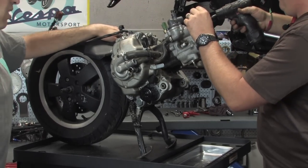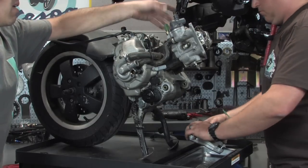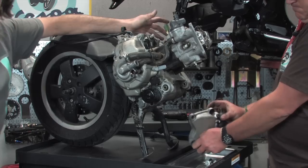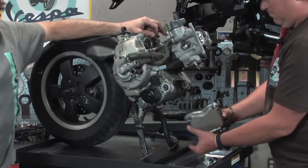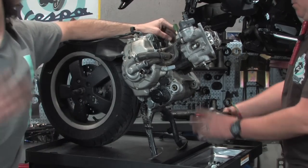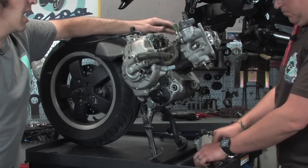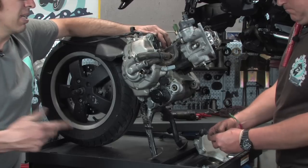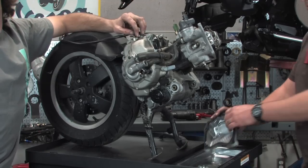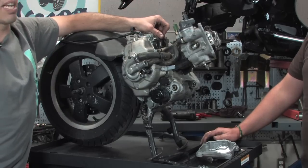When you attempt to crank this motor over, it doesn't even crank, because right now the combustion chambers fill with water because of problems with the warped head and the blown head gasket. You can even see in here, there's actually liquid water in the exhaust port. It's essentially hydrolocked. Whenever somebody talks about a hydrolocked engine, it usually means there's a liquid that's filled up the combustion chamber. An engine's basically a glorified pump, pumping fuel mixed with air, which is a gas, and then pumping out the exhaust gas. It can pump a gas because gas is compressible, but you cannot compress a liquid. So the piston basically won't turn over because it can't compress the liquid in the cylinder. And it's not supposed to have liquid in the combustion chamber anyway, so when you try to crank it, it just feels like a locked up motor.